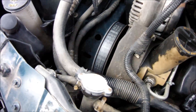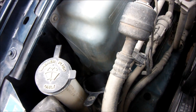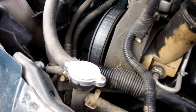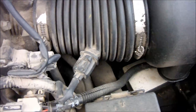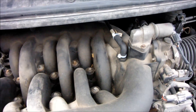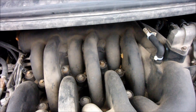It's not a big leak, but there's a leak. The reservoir works two ways — it pushes the excessive hot antifreeze overflowing into the reservoir, and then back out again as it siphons back. This van has factory clamps on it and one of them is leaking — somewhere here, or back where the thermostat is, or underneath, because this van has an auxiliary heater in the back seats.